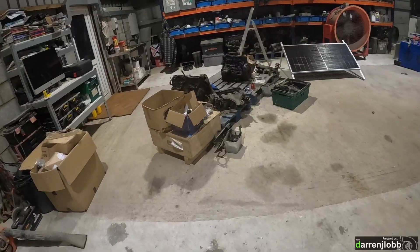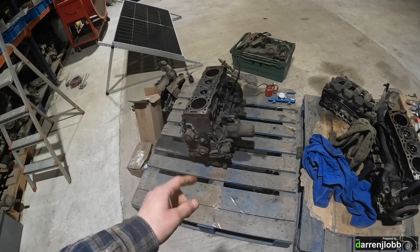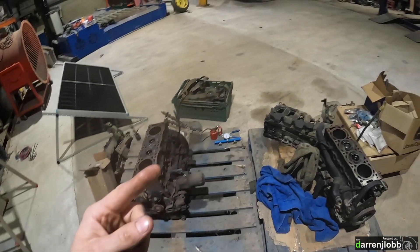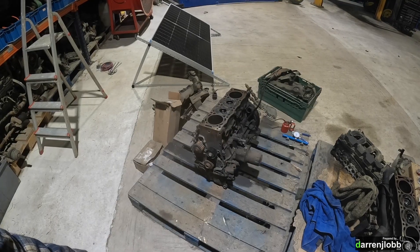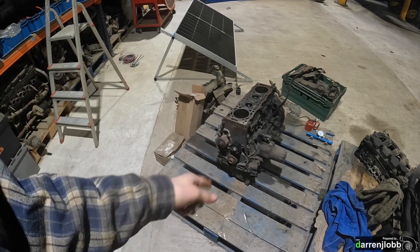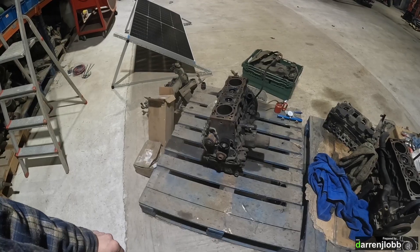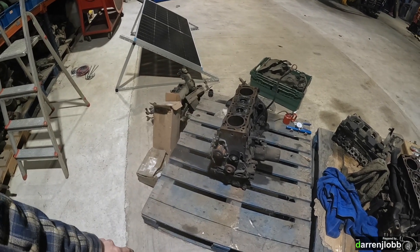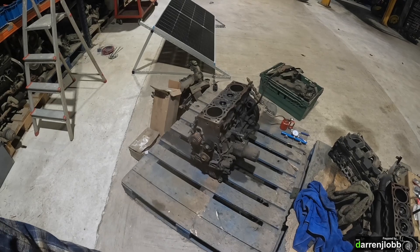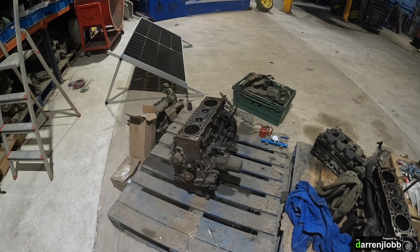So we're going to be moving on to a new block. I've got another donor engine which we had out of a scrap car — that one there. I've already got the block fairly stripped down, originally just to do a piston protrusion comparison between a bone stock engine and mine to confirm how far out we were. So we're going to pull the clutch, flywheel, oil filter housing, tensioners, water pump, dipstick tube — turn it upside down, pull the sump off, undo all the caps, pull the pistons and rods out. Just want to get this down to a bare block so I can clean it up and hone it out. We'll then reassemble with a different set of rods that are the correct length and a different set of pistons from a second gen. I'll stick this on a timelapse and we'll get this apart.